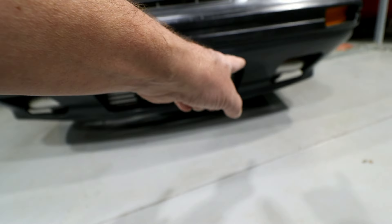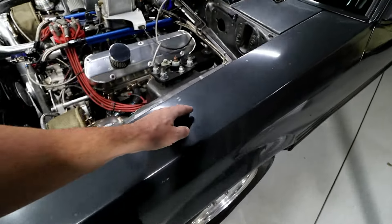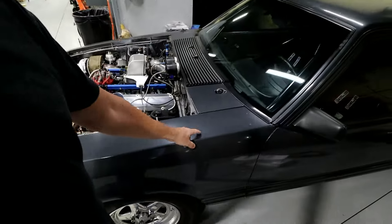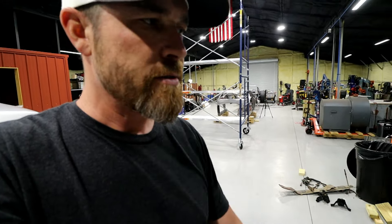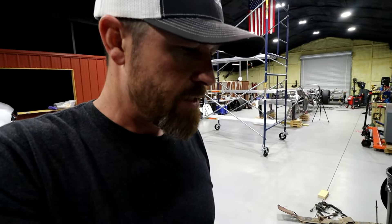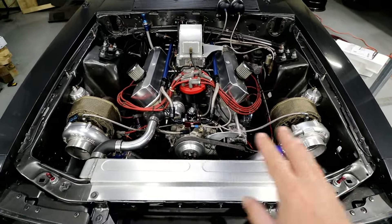The compressed air goes down through and on this one it all ties into one tube that then wraps around and comes up front through the intercooler, which is up front. The tubing actually comes up through the fender, goes into the cowl area, and then comes out and goes onto the motor. Same setup, same technology, same everything — this one is a little more compact and a little harder to work with but still ultra simple. The blow off on this one is in the fender on the piping itself. The only reason I went through the fender was just to make the engine bay clean — I wanted turbos, motor, and that's it.